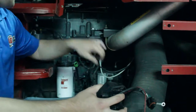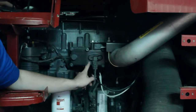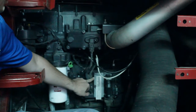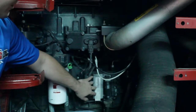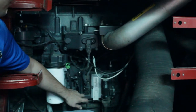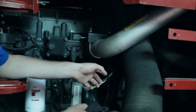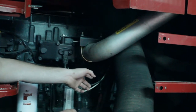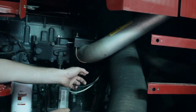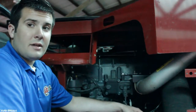For this install you're going to have two main connection points: right here on the intake — that's your MAP sensor — and then the ECM plug on top. If you look at the ECM, the one you need is on top, and in order to get to it you'll have to take them both off. Then we're going to go to the alternator for our power and ground source. The power terminal takes a 15mm nut and the ground terminal takes a 12mm nut.